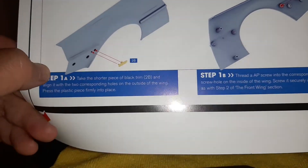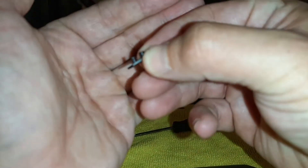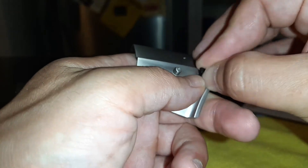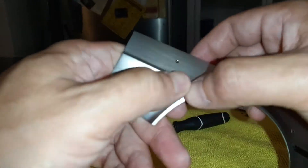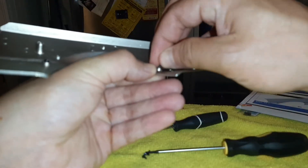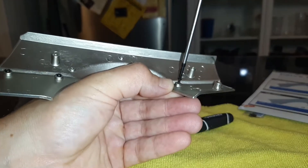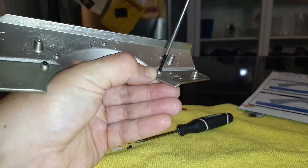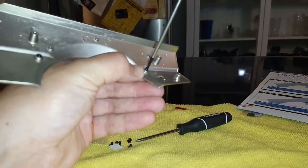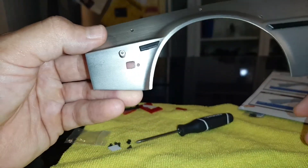In the next steps — step 1A and 1B — we are going to put the little piece of trim into the front fender. The little piece of trim has this little nub right here that goes into the right hole because it's nice and small. This piece of trim gets held in with one AP screw. The trick to screwing this one in: do not over-tighten it — tighten it just enough that it catches, because if you over-tighten it, this starts to bulge back out. And with that done, we're done with the fender.